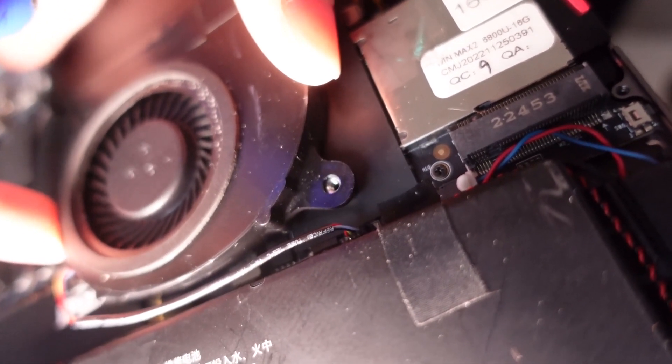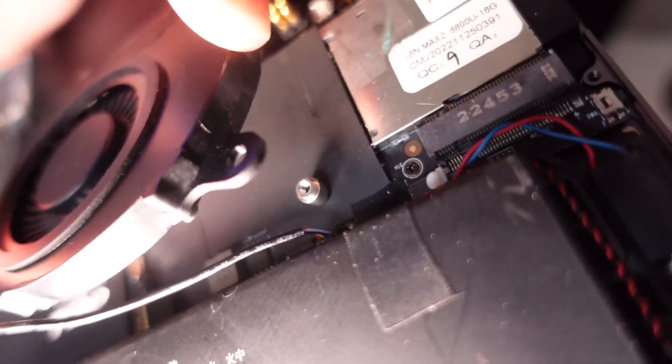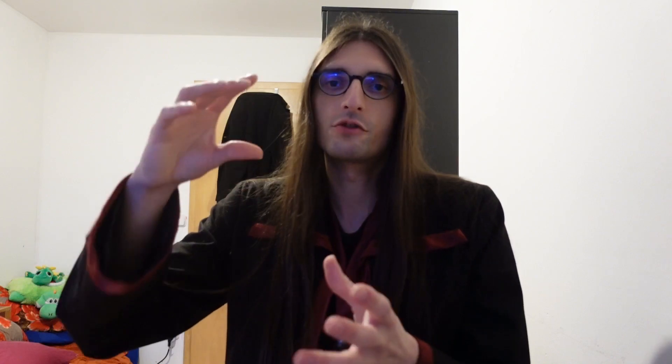Here is a little bit of resistance. Now I removed it. This little connection between the fan and the motherboard or the whole housing is what is responsible for the vibration of the fan being transferred to the whole unit and amplified. I booted up my unit with the backplate removed and as soon as the fan touched this little socket, even if it wasn't clicked in but just touched it loosely, the vibration was all there and the noise was super loud.